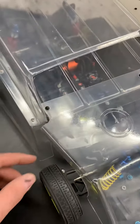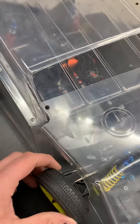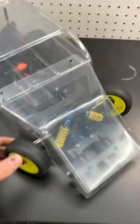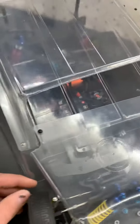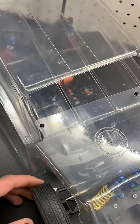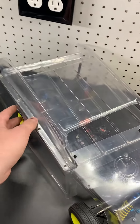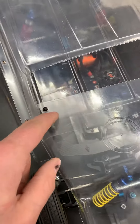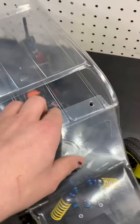The back holes are perfect — you need to leave three-quarters of an inch here. That's in the directions that come with the body when you get it; it tells you all about it. You can also read on dirtoval.com in the rule section under Midwest Modified if you want to know more. You leave that gap there and you have plenty of room to put one set of posts.